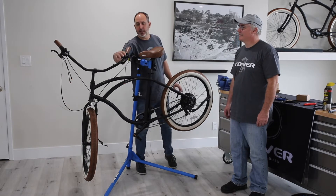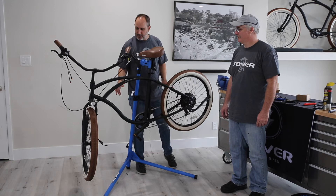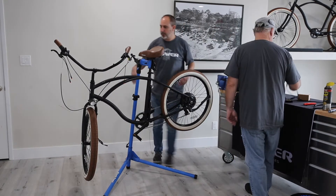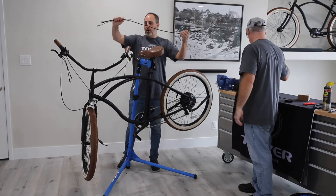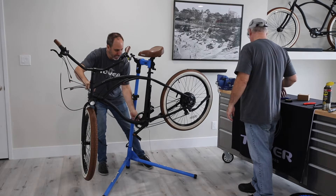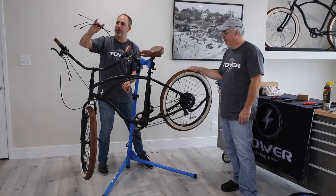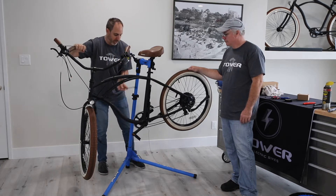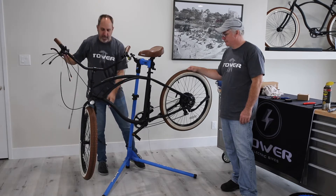The first part we did was replacing the LCD screen. Step two of troubleshooting is we're going to replace the whole electrical harness. This is your whole electrical harness — it sort of feeds through like this. We're going to fish this out, because you've got a bunch of stuff up here on the top of the electrical harness and only one might plug in on the back, so you're going to fish that out through this hole and that hole.